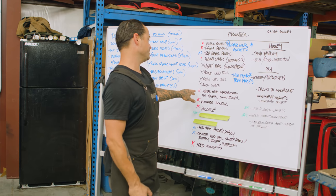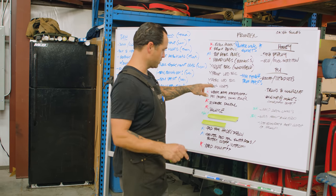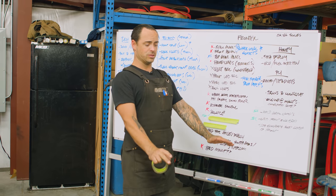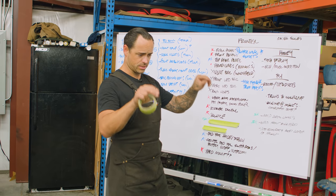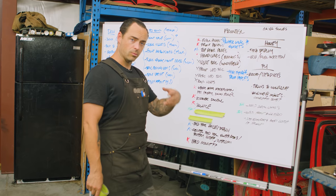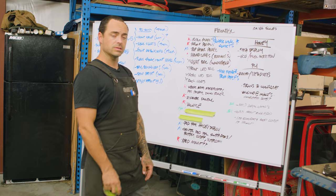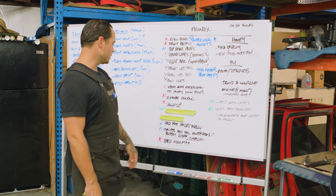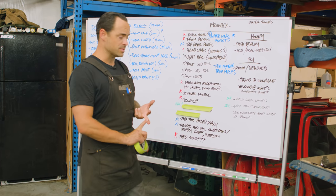Upper arm modification. We're probably not going to tag that one in this next episode, but the upper arm has a cross section, and when the front suspension droops out, it has a clearance issue where the rack wants to hit on an area. So we're going to modify that and redo it in a way where we can get the extra 2 inches of travel that it has. It's limited by that, and it's really sucking up some real estate. So that's a thing.